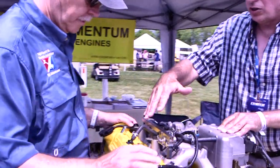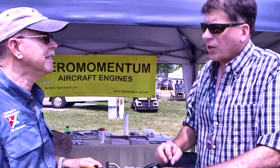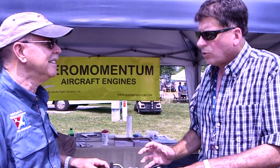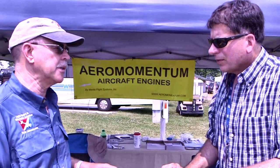How much do you have to change the engine? You get a long block — tell me what that means and what you do to change it. The actual mechanical engine doesn't change that much. We do use a different profile camshaft within the head, and this version has the heavier, stronger crank — most of the versions sold in this country have the lighter crank, which is fine for automobile applications. This long block and crankshaft is used in the 90 horsepower Suzuki outboard, and they get about four to five thousand hours in commercial use on those outboards. I can't imagine they're taken as well care of as we tend to in aviation, so that's really saying something.